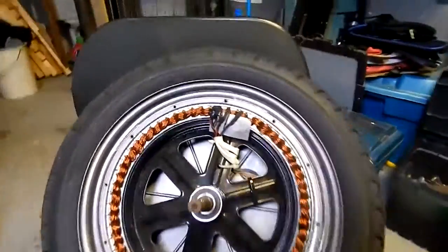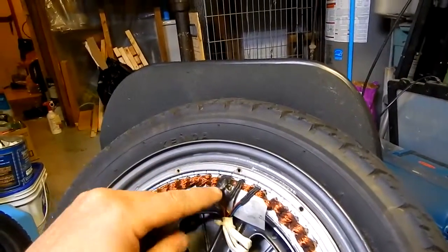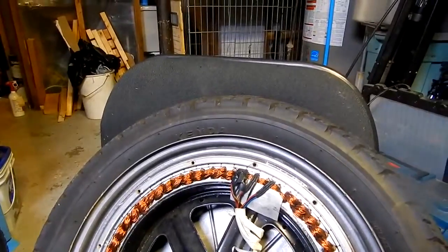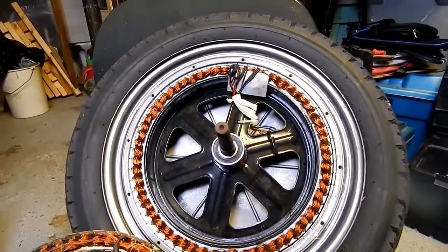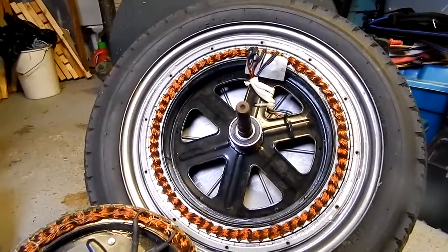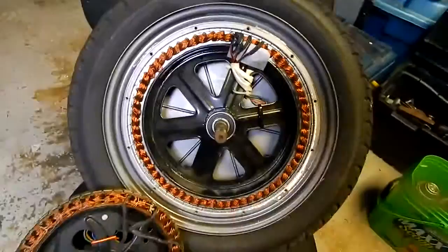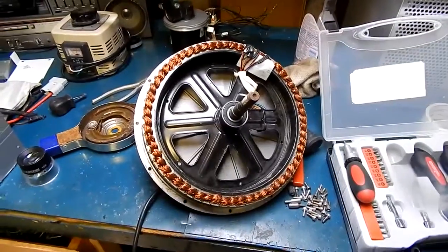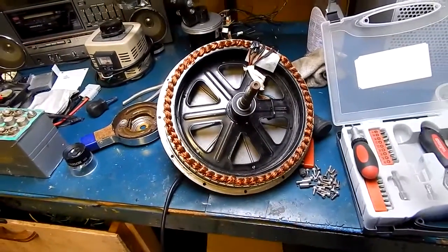As you can see, someone did a little bit of work on the one hall there, so I'm just going to finish pulling it open and see if we can fix the wiring harness and the one hall. As you can see, the size difference is amazing. One thing I hate is people that pull these motors open and have no idea what they're doing.